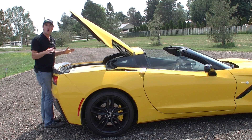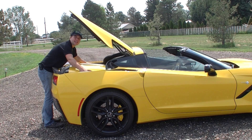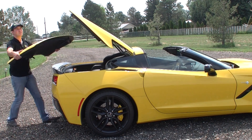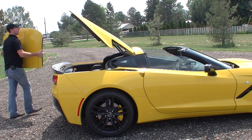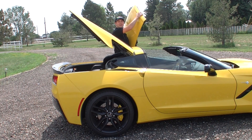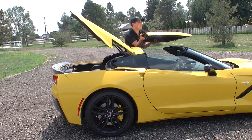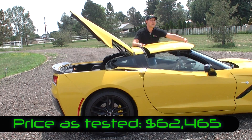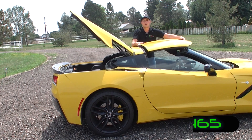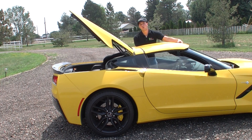Make sure you get a good hold of this — this is not a cheap panel and neither is the paint. Remember that if you drop it, you're going to do some significant scarring to the panel. So take it out, get a good hold on it. Now here's the tricky part: how do I get it across the car? I like to grab it in the middle and just ease it down so that it's sitting on the rubber of the front of the roof. You then have to try to line it up with the rear holes.